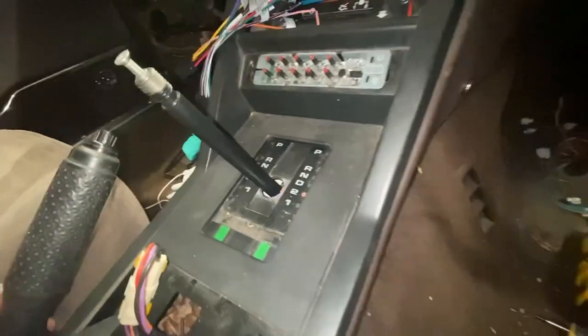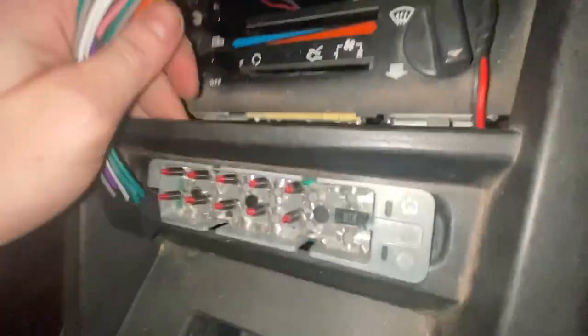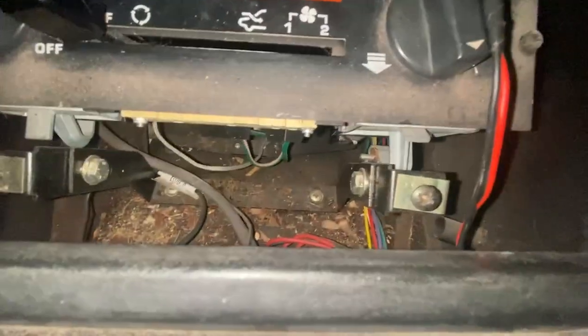You don't have to get the trip computer housing out all the way — you can just get it out part way and then sneak a screwdriver in past it. So that's these two brackets here, and then there are two more down at the very front corners if you're lucky. Mine only had one because I think it's been a little bit neglected in its past.